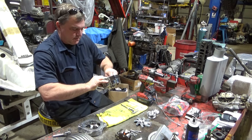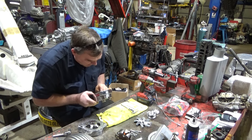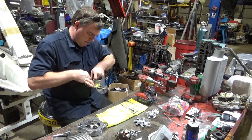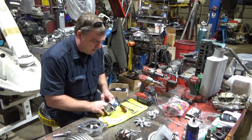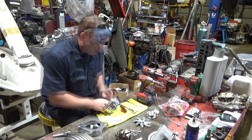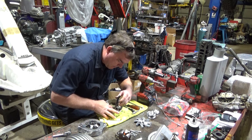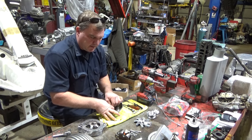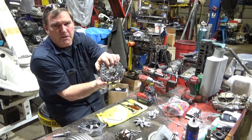My brushes look pretty good, all things considered. I'll put a drill bit in to hold it. These bushings haven't even worn through the eyelet. I'm going to need a pair of pliers or a smaller pair of fingers. All right, a pair of needle-nose pliers. I win — slippery little sucker. Now your brushes are held into the piece with a drill bit. Pull out and put all that together.